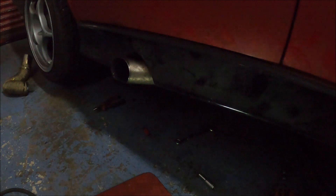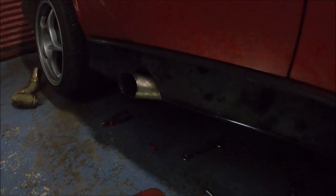I added an exhaust mount — it's hard but it's got a little bit of give. Without that, when I bought the car it didn't have a mount there, it was just loose and it wobbled and rattled a bit, but that stops it. This is what I mean about testing rather than just presuming and guessing like most people do. I tested that race cat to see if it was restrictive or not, and yeah it was — so it's gone. You can't just presume things are or aren't. If you can test it somehow — doesn't have to be the best test in the world — something that gives you a good indication.